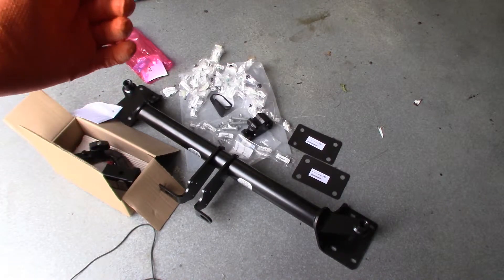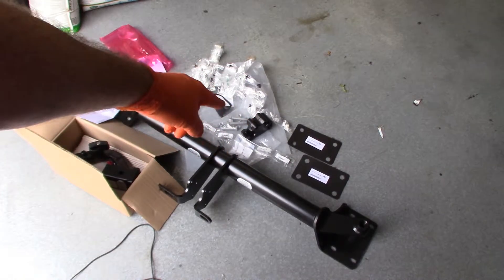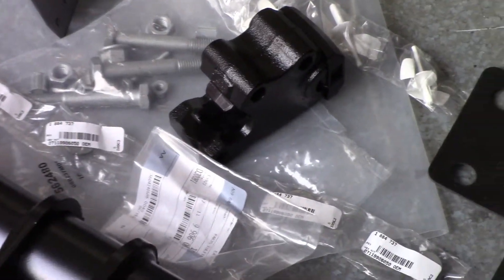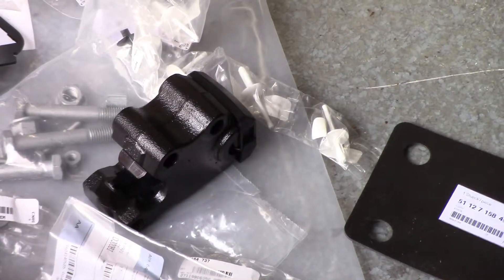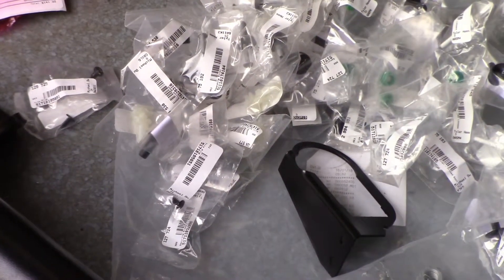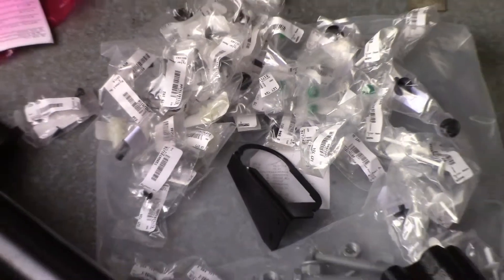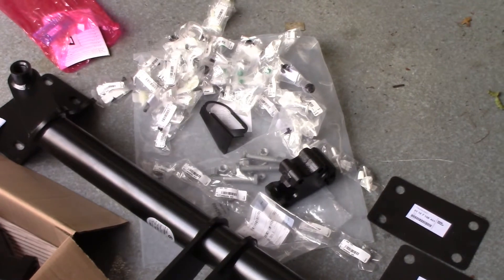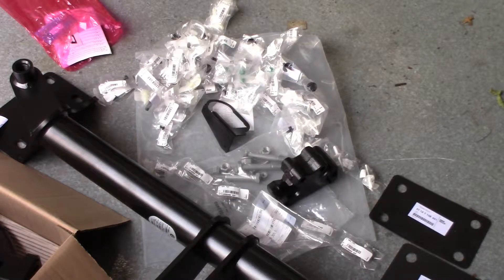There are some of them that I know have to be broken to get off — they cannot be reused. So those little plastic rivets, you can see some of those up here. If you zoom in, you can see some of those little white plastic rivets, and there are some black plastic rivets up there as well, as well as a few little spacers and some grommets. Just in case you get in there and these things are breaking off, it's just not worth it to do all this work and have a 98-cent piece that you don't have and you can't put it back together. So I always keep extra little things around. I just went online to realoem.com, looked at all the different parts that support this bumper cover and the pieces around it, and that's how I came up with what to get.